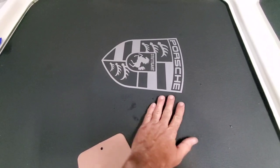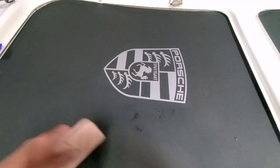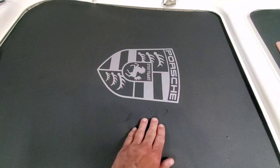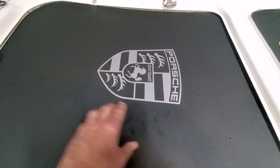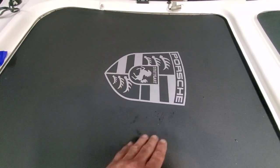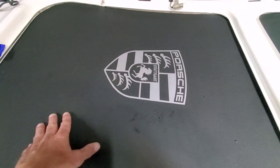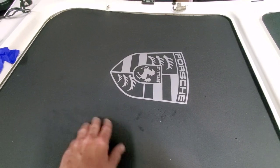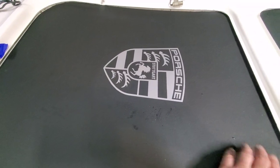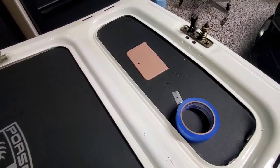The only thing I really didn't follow in the instructions on is that I folded it, being by myself. I pre-inserted it, made sure it fit, and folded back the big half first. It's wider at the base end of the hood than at the other end, so I folded that part back first, put the adhesive on both the bonnet and the material, put it down, let it sit for about 3 minutes, then peeled the other side back and did the same thing, sprayed it, and put it on. On the top part, I just dropped it in there.